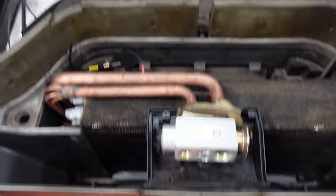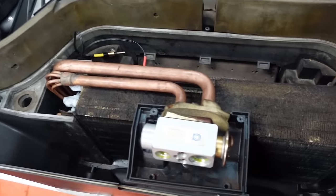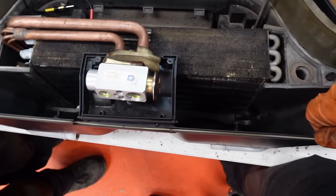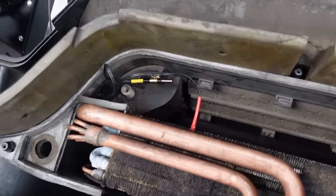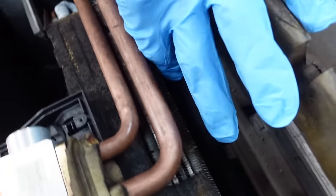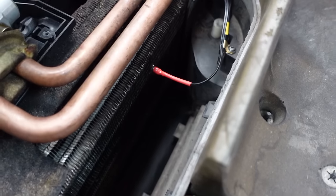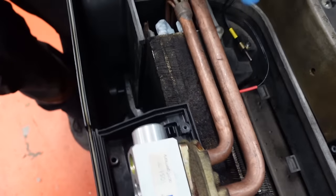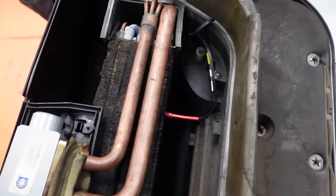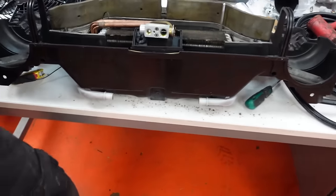The evaporator, although old, is actually in really good condition. Jay's made a really tidy bit of routing for the sensors here. One of them clipped in, one actually goes in the fins and we put a bit of glue there. One stops it from freezing and the other is just an air temp sensor. So if anybody from Classic Retrofit thinks we've done this wrong, don't tell us please - because this is how it stays.